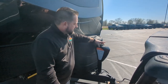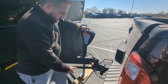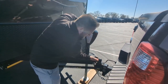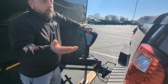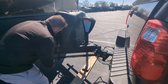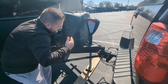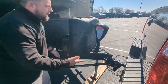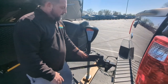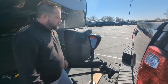What will happen is, if you still have weight on there, you won't be able to unhook it because you've got the weight against the foot. As you can see now, we've got the pressure off and now we're against the ball — we're raising the truck up off of it. We only moved about an inch, so that's about all the further you're going to have to go to get it up off of there. We're going to unpin this, and then you can move the bar — you can see we can still go over the top of it, no problem. If we still had weight on there when you kick this off, that may drop down, it's going to shift the trailer, and it's probably going to freak out a little bit. Once you're in that position, you can't unlock this — it's too tight because we're against it. So you'd actually have to lower the truck back down, get the pressure off the ball, unlock it, raise it back up off the ball, then you can pull it out. That's pretty much it on hitching and unhitching on the weight distribution system.